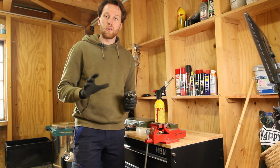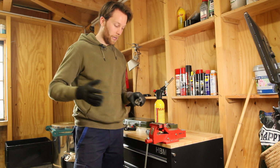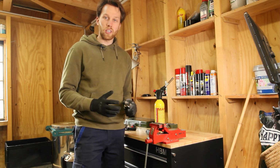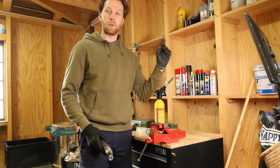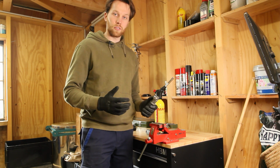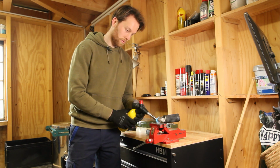One thing that is so nice about this very specific bike is that the previous owner used copper paste on basically any screw, and that makes it so easy to disassemble it. So these Footpeg mounts and obviously the exhaust screws, and I'm going to link you that video up here if you haven't watched it yet, are the only ones where I actually have to use some force, or in this case heat, to get them off.